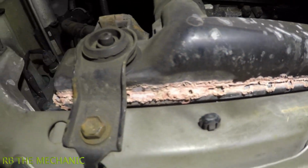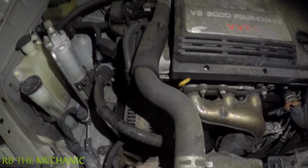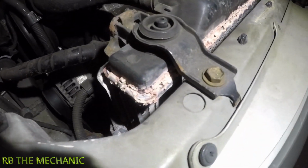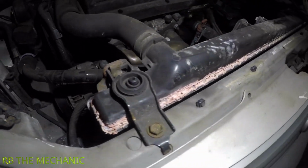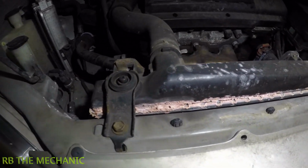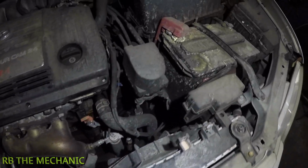If you see something like that around your radiator or anywhere, that component is leaking, guys. Anything to do with coolant, right? So this system takes a pink antifreeze. So that's what it was doing. It was building, trying to seal itself. And you see the splash everywhere, guys.